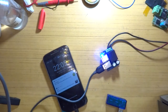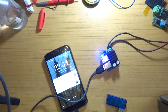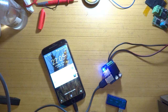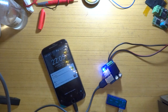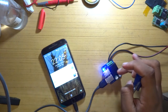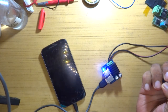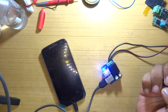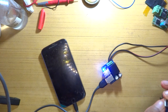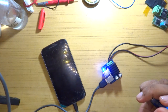The 30-minute mark has now arrived and we're at around 40%, so that's a 20% increase in 30 minutes. According to my phone, charging will complete in one hour and 30 minutes, which is extremely good considering this is not a quick-charge device. In quick charge I can go from 18% to 90-100% in about one and a half hours. The first 10 minutes were slow — it took 10 minutes to go from 18% to 20% — but then another 20 minutes to go from 20% to 40%, which is a solid charging speed.